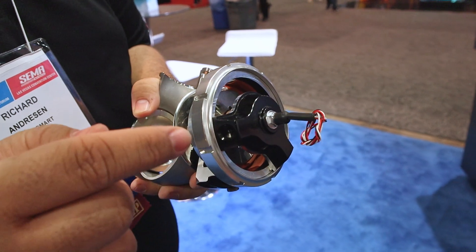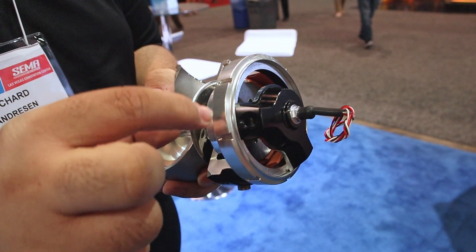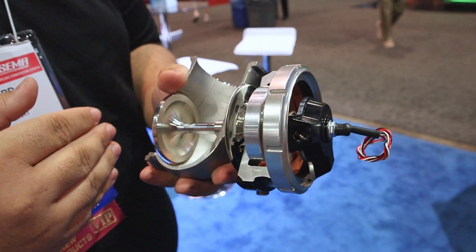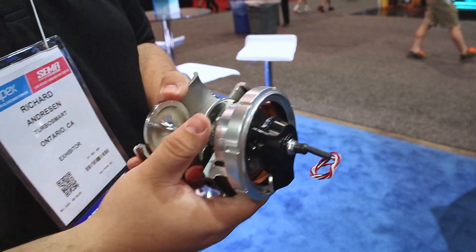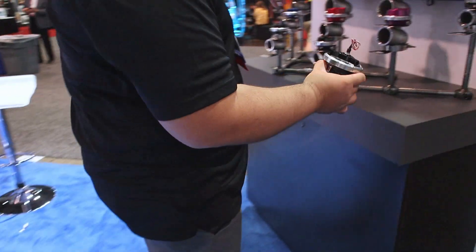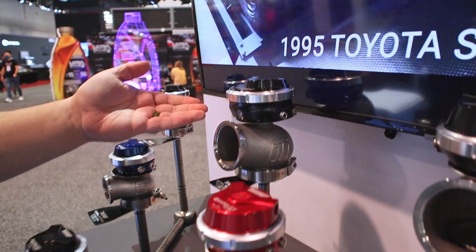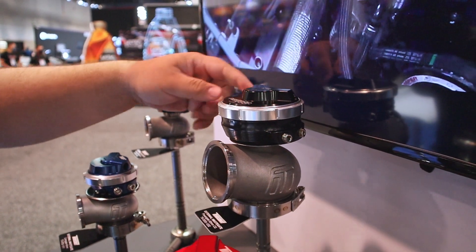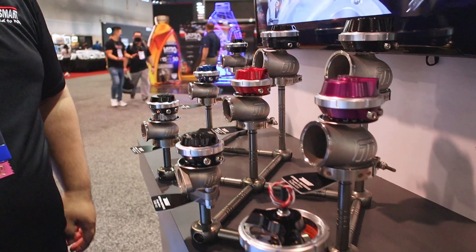What guys will do is feed pressure to both the top and bottom to counteract the movement of the diaphragm, which gives you a little bit more control over how that valve moves. And in some of the more extreme versions of motorsports, we have a compressed gas gate. We flip the diaphragm upside down because some people will feed compressed air or CO2 into the housing, and that way they can control how that valve moves rather than having to depend on the reference below.